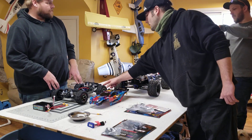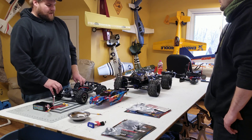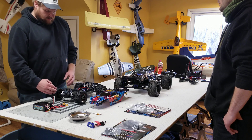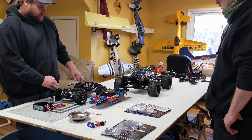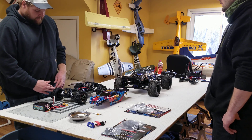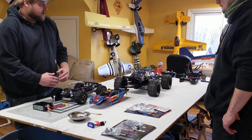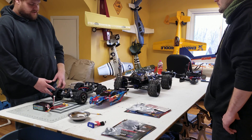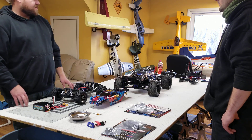What's the benefit of being able to change the hub size — is it for different tires? Mainly so you can mount it to a different truck for flexibility. This truck's wheels are both a 13 or 14 millimeter hex hub. You can change the offset of the wheel to adapt to different trucks, using the same wheel and tire on different trucks and have the same performance.